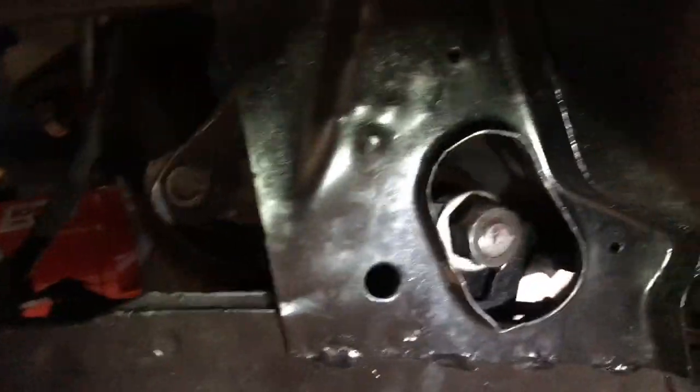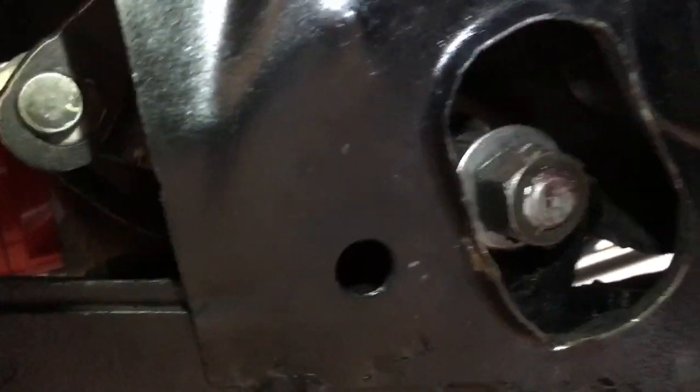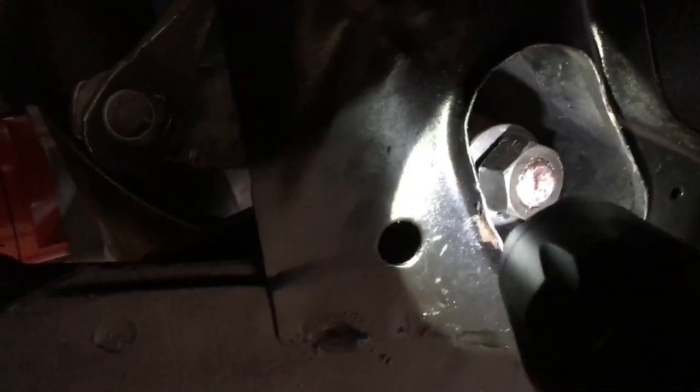This bolt tightens down over here, and then you secure the other ends to your clutch and you're done. Here are some final tips about putting in the z-bar. I still need to clamp on the pull and push rods. There's a bolt on this one — I put a washer on the back side. On the back side of this assembly there are two flat grooves where you can put your wrench. The only way to get the wrench in is from the back side — there's just about no other way based on how it's designed.